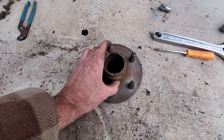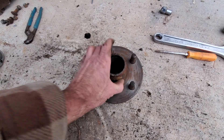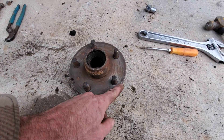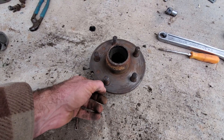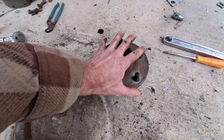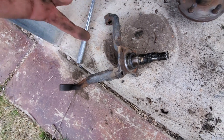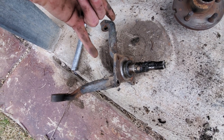I just double-checked: the measurement of this diameter is about 61.7 millimeters, and on the Toyota Highlander the same point for the rotor to fit over is 62 millimeters, so it should slide right over this. The only thing I need to do is make sure this outer diameter is cut down. I have access to some really nice lathes at work and should be able to pull probably a good solid eighth inch out on each side — so a quarter inch smaller diameter altogether — and then that rotor should just fit right over the top.